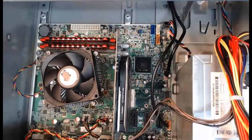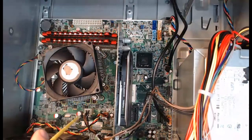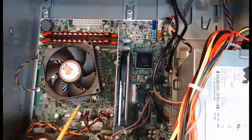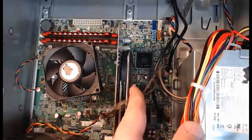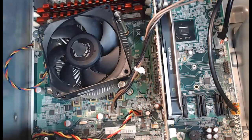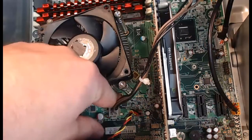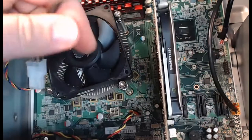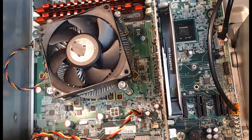We're not done yet because inside the case there's also the ATX CPU power connector. You may not have this on your board — it really depends on your computer. This one also has a little lever. It's a 4-pin connector and it has a clip on it as well. I'll reach my hand in there, put my thumb on that lever, and pull straight up. That's the 4-pin ATX CPU power connector that gives extra power to the board for our components.